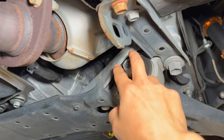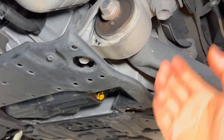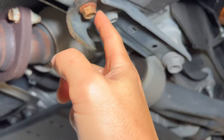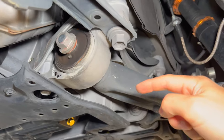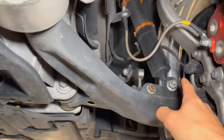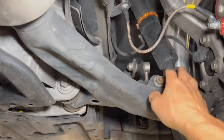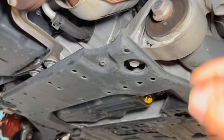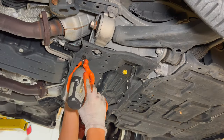In order to remove this thing, you basically have to take off this 22mm here and another 22mm over on these two spots, and it drops that whole thing down - but it doesn't drop down that easily. You still have to take apart this bracket, which is some 14mm bolts. Once you have all that loose, you have to pry this arm down against the subframe to get it to clear the little lip. To do that, you must unbolt the shock from its control arm so you have that free. Once you unbolt this, you'll be able to move this thing about a half inch to slide it out. You want to remove this plastic too while you're under here, just to give a little more clearance.